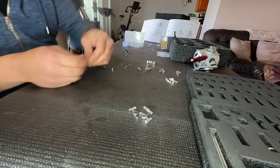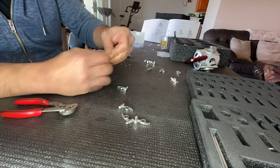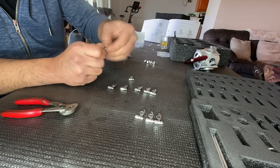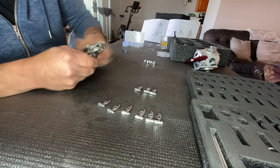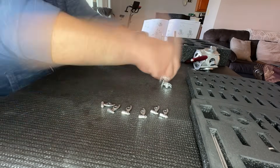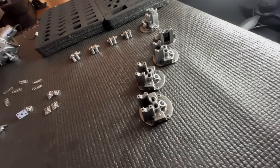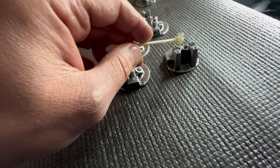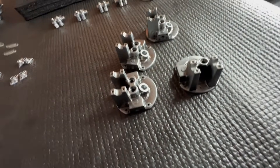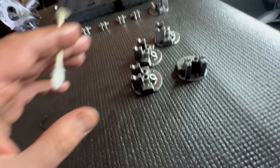One thing I remember from A&P school is that we used to disassemble Continental flat-six engines — take them all apart, inspect all the internals, use depth gauges and micrometers to make sure all the gaps are correct, document all of it, and put it back together. Very tedious work, especially if you're a technician rebuilding these engines. In the powerplant portion of A&P school you learn components, how to use proper tooling, and most importantly how to use maintenance manuals and illustrated parts catalogs. Now we're starting to assemble the cylinder blocks — I can't stress enough how much lube you actually need for this build.